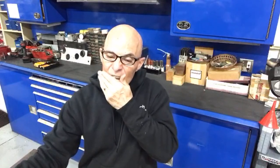And then when you bust the line off of the wastegate, two things happen. One, because that line was being shared by the map sensor, it says, hey, what's going on here? And also because the wastegate no longer has a signal, it says, okay, I guess you want me closed all the way. So let's party now. And so I'll show you one of the runs where I just pulled the stick back and aborted the run. You could see in the run that it was on a mission. It was kind of ready to go. But we don't want to do that.